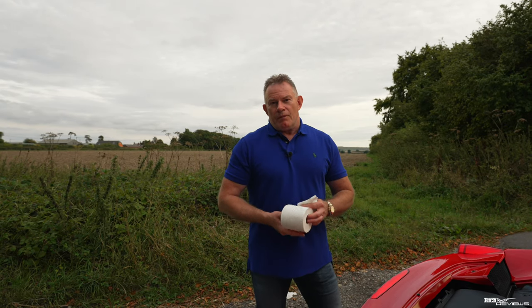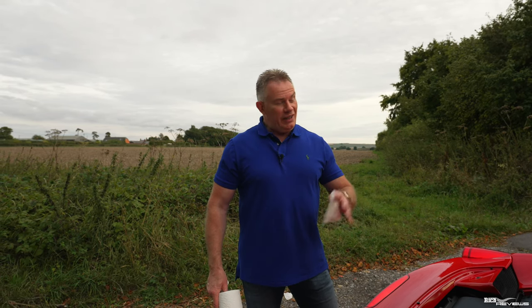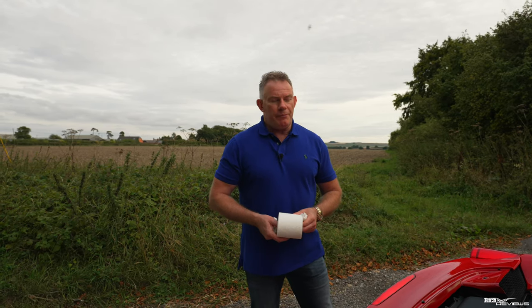Very important, and oil is vital in these cars. Even though they say that as long as you get the car serviced by a dealership, you don't really need to check it in between the servicing, if the car goes out of oil, the engine's ruined and you're into a massive bill. So I check the oil around every couple of months, not too often. As long as you know the car isn't burning much oil, then if it drops, there's a problem. So if you check it fairly regularly yourself, then you'll know if suddenly the oil level's a bit lower.